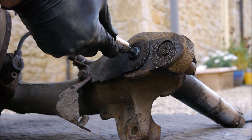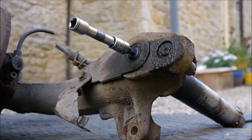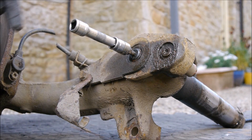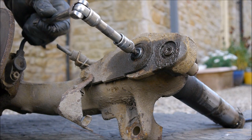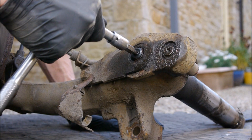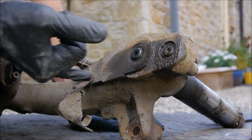So we're removing that plastic bung, then I'll show you how to take the anti-roll bar plate off. On mine I've put a different bolt with a different slotted head, but the principles are the same. Sometimes the bung needs a bit of encouragement — you can see it wants to go. You might find it starts spinning, in which case try bigger Torx bits. I've also had to drill them out, which is a problem if you don't have replacements.